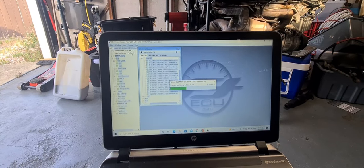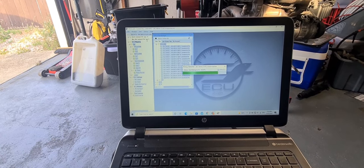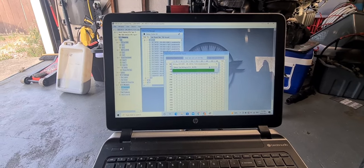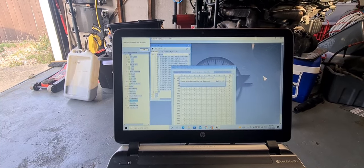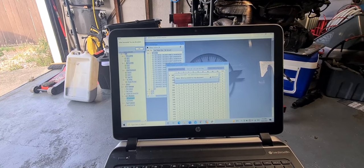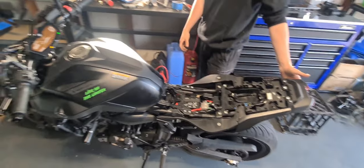We are uploading the de-restricted file to the ECU — this was really complicated and I'm not a fan — but hopefully the bike is fast enough to make all this work worth it. After flashing the ECU, we were able to extract a fuel map that we found on another website, set up for this airbox and air filter with this exhaust and this setup, and we've just successfully put that into the ECU. This should be the end of this job as long as the bike starts and rides. That's a good first sign — we messed around with the ECU and the bike still starts.